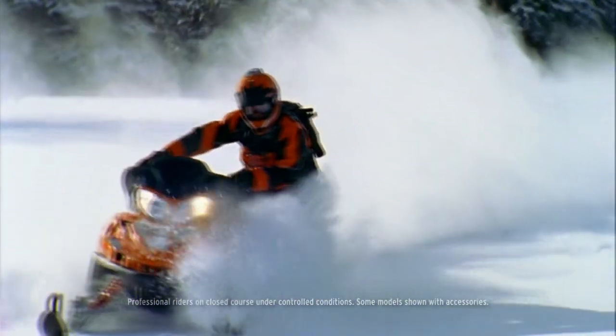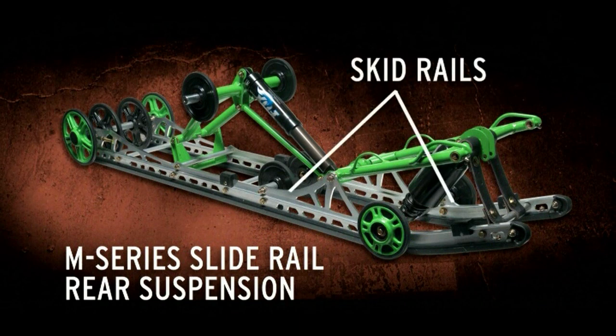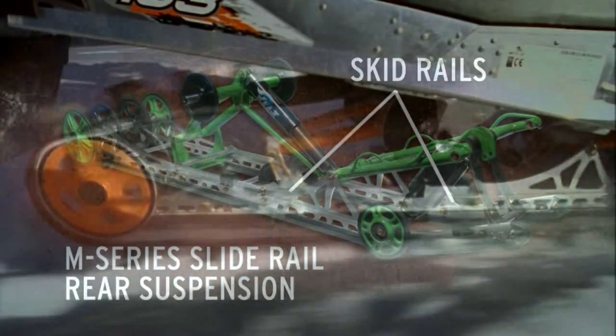So we focused in on the rear suspension. We were able to take off about 8 pounds by eliminating the torsion springs in the rear suspension. We redid the skid rails and some of the other things just to reduce weight and give the whole suspension an open, airy feel.